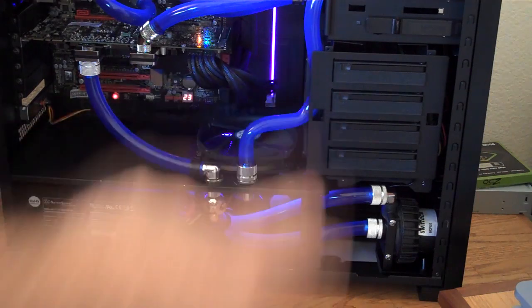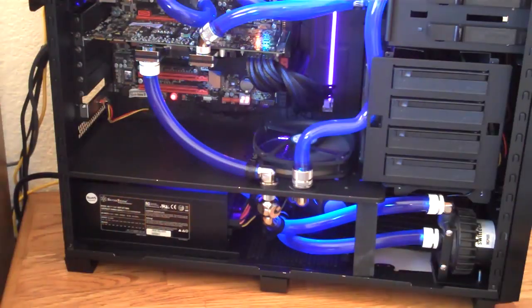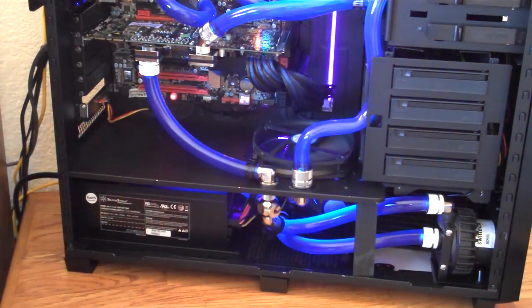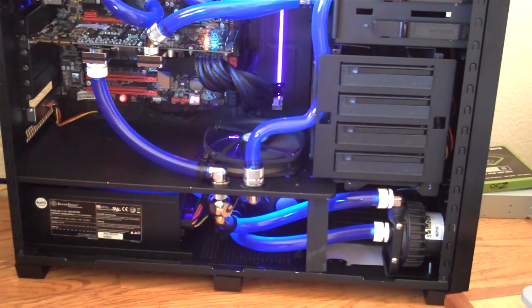You'll also see that we rotated where the hard drives sit. So instead of the hard drives having to be accessed from the front, they're now accessed from inside the case. To mount it in there, all I did was loosen it from the way it was mounted inside the case. Be careful because down low, when you're pulling this out, there's four black pins that are holding it in place. They're not screws, they're pins. I actually just broke the pins off because you can't reuse them. They don't line up when you turn it sideways. And then I just tapped a couple new screws and used some bolts to fasten it in place. Very simple, pretty easy.